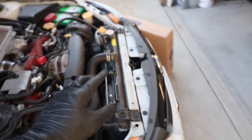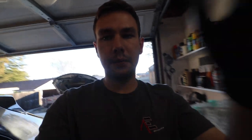Now we can move on to swapping out the radiator. I really should have let the car sit a while before doing this because I know that coolant's going to be burning hot. Just a little note for you guys — if you're going to be doing this, maybe let the car sit for a couple hours before you start to drain the boiling hot coolant.